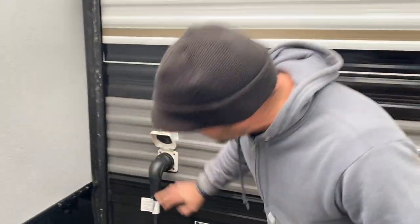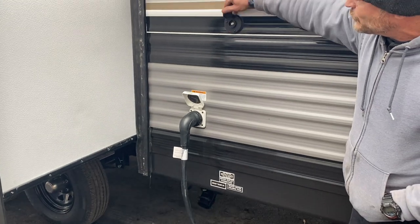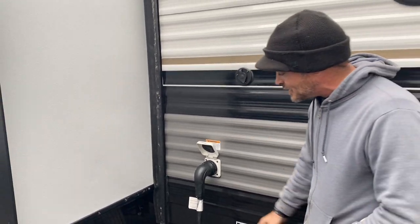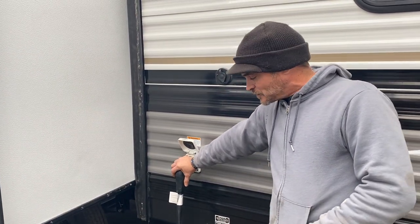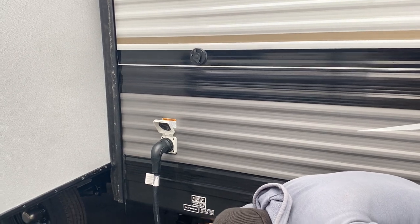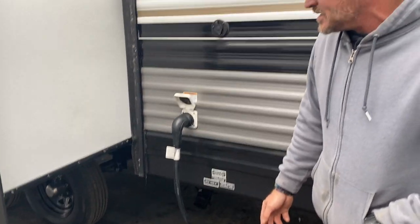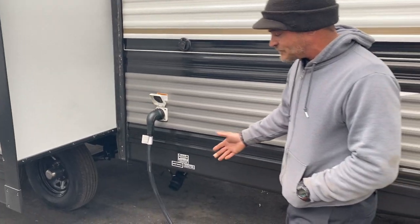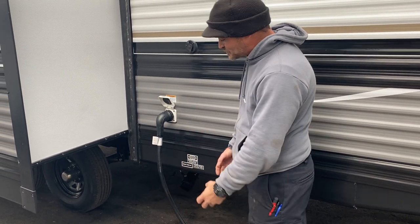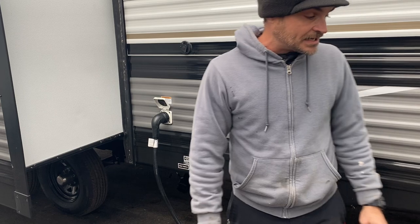Over here we have our electrical station and also our sewer station. There's a plug for our cable — get yourself a 25-foot run of cable to connect to the park cable and the cable on the camper. This is your 50-amp, 25-foot power cord that comes with the unit; it will be in the front compartment. Down below we have your sewage connection — you have your gray handle and your black handle for your gray tanks and your black tanks. If you're boondock dry camping, make sure those gate valves are closed. If you have a dump station on your campsite, simply connect your sewage hose, pull your gate valves open, and it will allow you to utilize plumbing like at home.